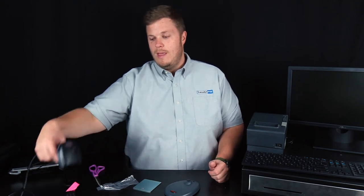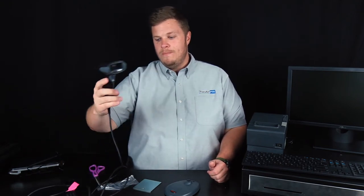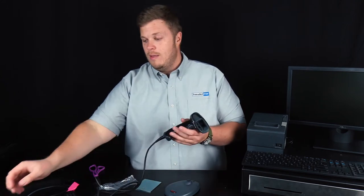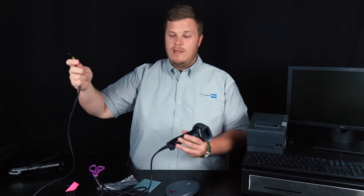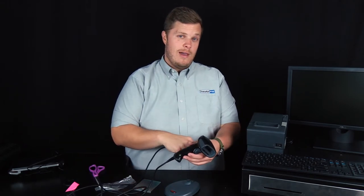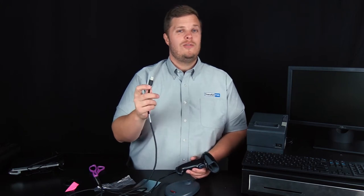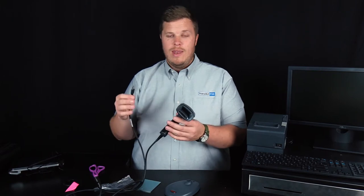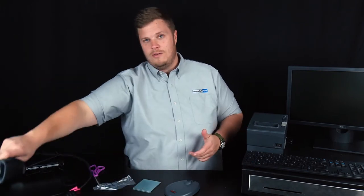The last thing we're going to talk about with a typical point-of-sale workstation is the barcode scanner. Usually it's something like this, a Honeywell 1300G. It'll come configured, ready to do a carriage return and all that sort of thing. The main thing you need to do is get it out of its packaging, take the USB cable, run it underneath your counter to your computer, and plug it into an available USB port. The unit should give a distinct beep when it's on, and you can hit the trigger — it's ready to scan if you see the red laser.